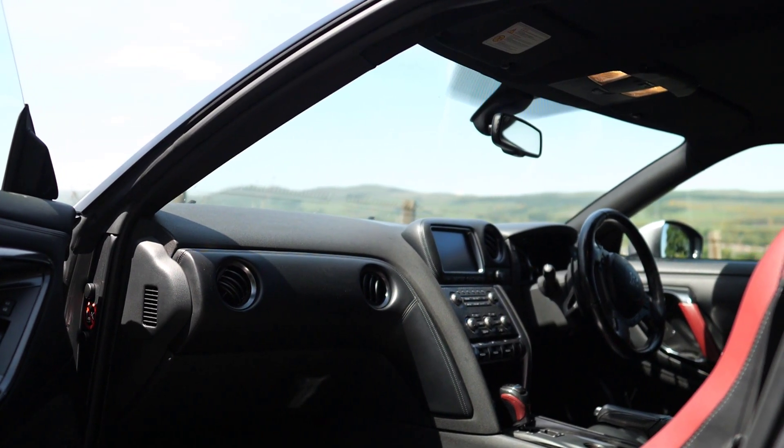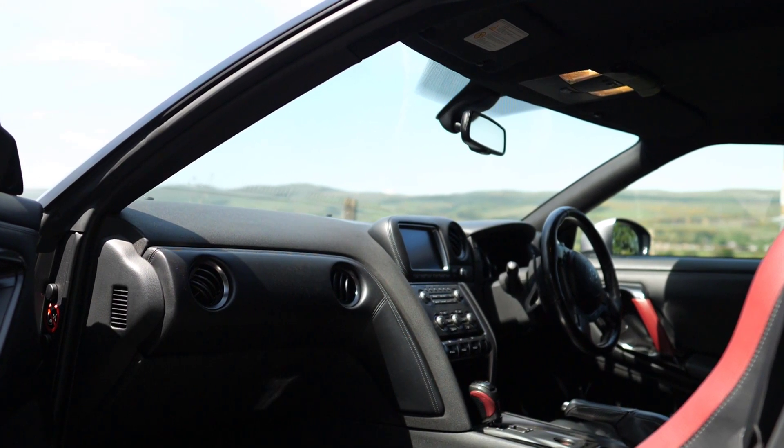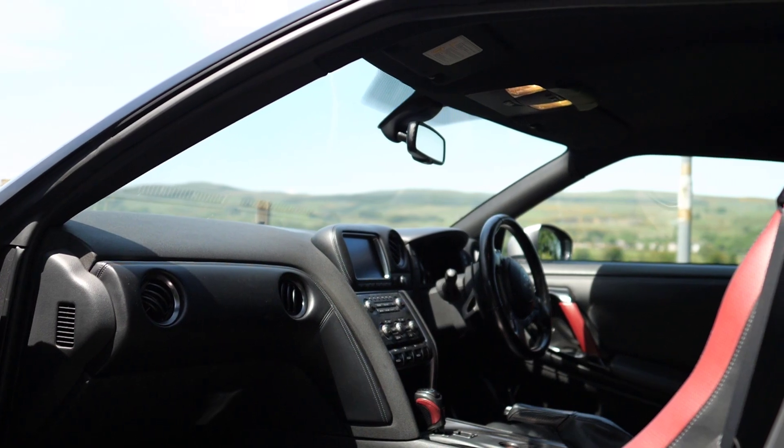I think we've picked the hottest day in Scotland ever to do this — it's a million degrees in here — so let's make this swift. First things first, hit that start button and allow it to come fully on ignition. What we're listening for here is a clicking that comes from the back left-hand corner. If you hear that clicking, it indicates that you're sat in a GTR with a factory tracker fitted. Now why I bring this up: that tracker will have two tracker fobs supplied with it. Make sure you get them from the seller, because even if he tells you it's been disabled or not worked for 10 years, you still need those tracker fobs — sometimes it needs a reset, and without pressing the button on the tracker to communicate with the car, you're stranded and the car won't start.